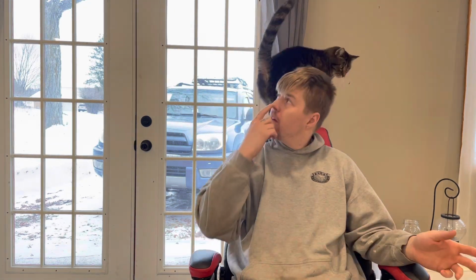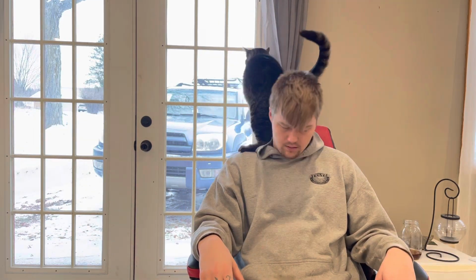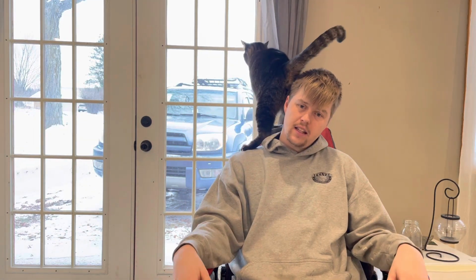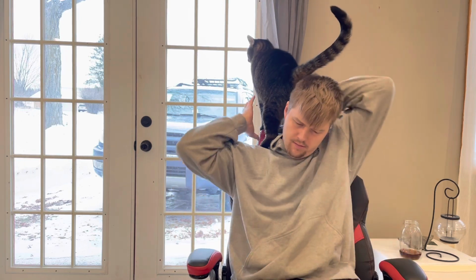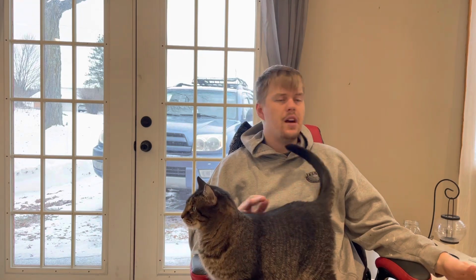So yes, I did end up doing the roll bars per se. I did the, Steve, you're always showing your best end on camera, aren't you? So I got the side bars all completed, which is very exciting. That was a much easier process than I thought it was gonna be. I took 400 grit, I went over it. It was very surface rust. It came off really easily. On a little bit of it, I hit it with some 600. I'll show you that real quick.